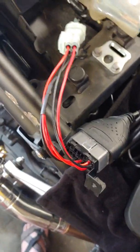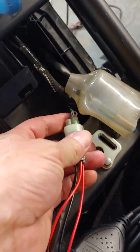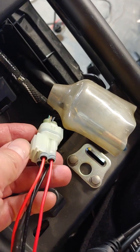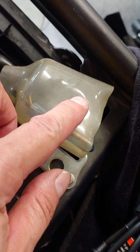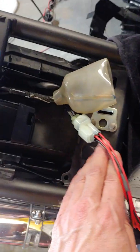Today in the garage I made myself a KDS — Kawasaki Data Socket or Data Systems, I'm not sure which it stands for — but it's a 4-pin OBD connector on the bike that is in this clear case. It's usually in this spot underneath the seat with the strap holding it down, and I have it out of the way here.